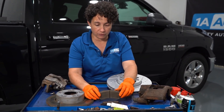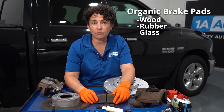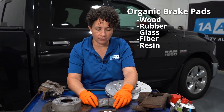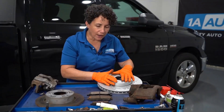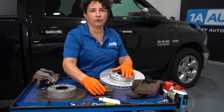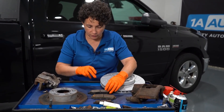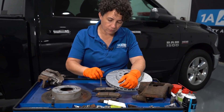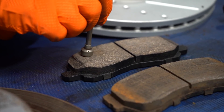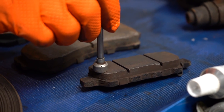I don't have any organic ones here. They're made of wood, rubber, glass, and some fiber, combined with a resin. What we do have is ceramic and semi-metallic. A quick way to tell the difference is to use a magnet. The ceramic pad — nothing. The semi-metallic pad lifts up because it's got metal in it.